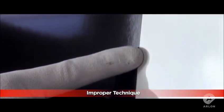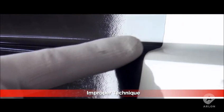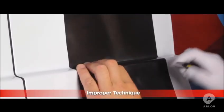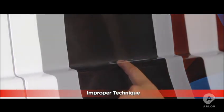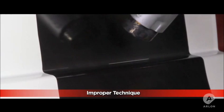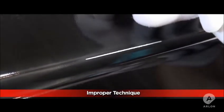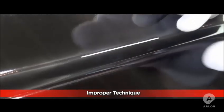The edge of the vinyl is straight until you get to the stretched area — that's where you see the stretch the most. Our channel test is to put a slice through the deepest part of the channel. If the vinyl opens up, and it has here, then we know for sure it will eventually lift. After applying heat, not only does it open up further but the edge of the cut is wavy because there is so much tension in the vinyl. This application was guaranteed to pop up.